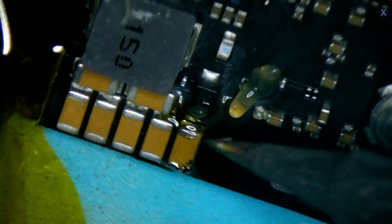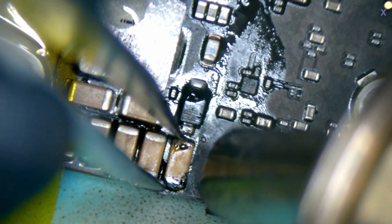We did lift up the processor heat sink and we did see there was a damage area pretty close to where this damage was. We're going to go ahead and do a reflow there to make sure it's good — it doesn't look to be burnt, just looks like a little bit of liquid got to the side there.